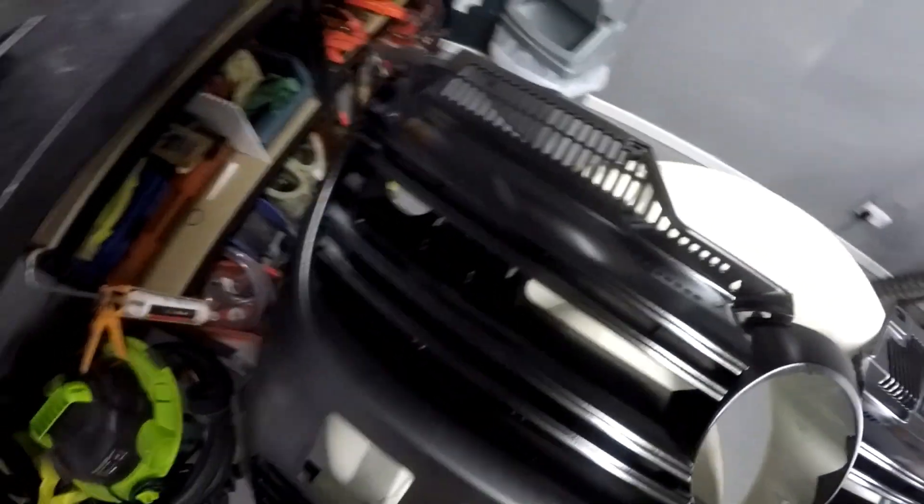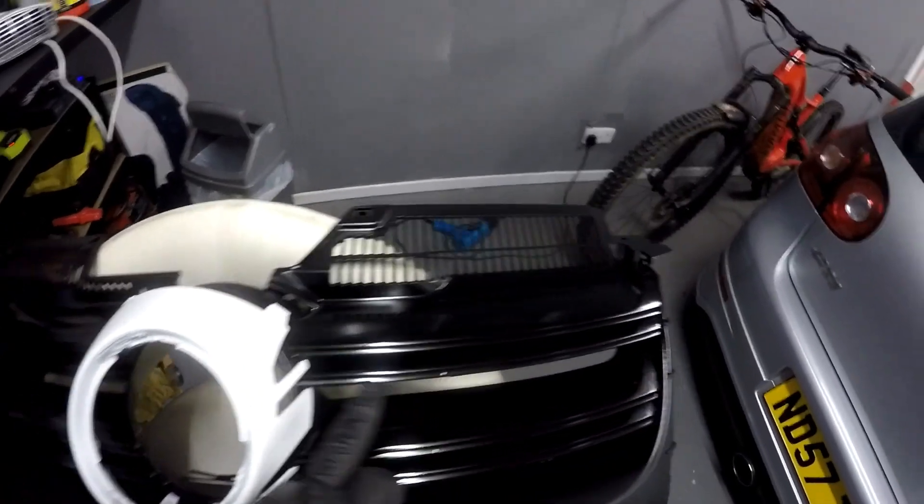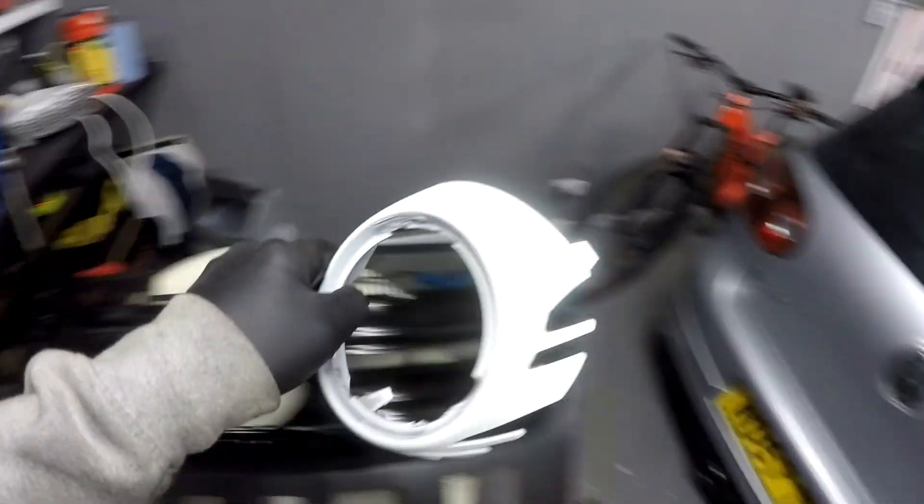Not bad at all - bottom grills too. Still going to flat it back with a bit of 2500 and a bar of soap, then polish it out. I was taught that many years ago - finish the paint off. That piece there is already primed. The dilemma I'm in is what color to do it - I've kept the grill black, taken all the chrome lines black as well. I don't know whether to do silver, graphite gray or something. I'm off to get paint this morning and we'll find out this afternoon.